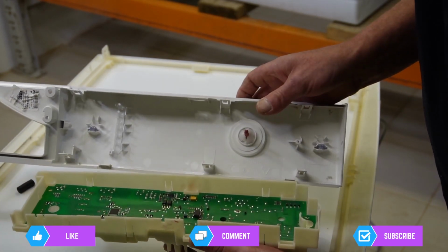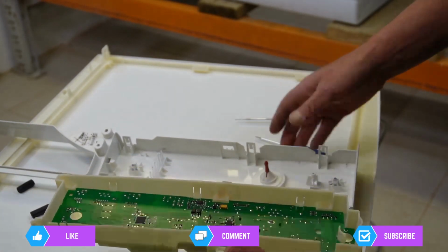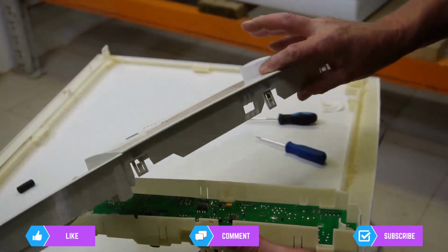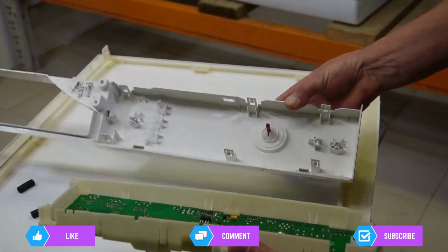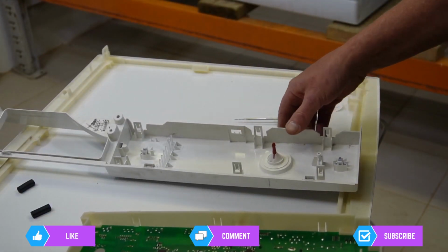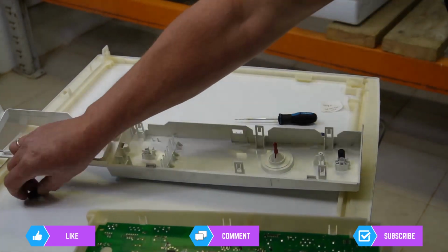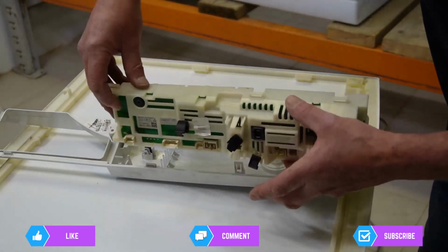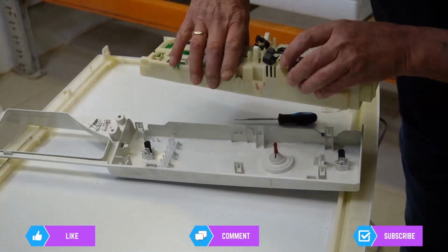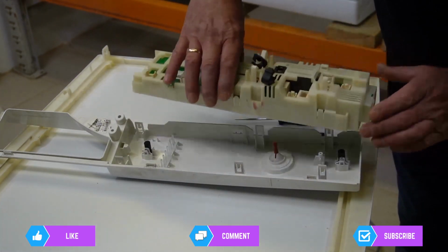Yep, he's actually sent this back by the look of it in the off position. And if I'm correct, that's the off position. So what we're going to do now is put these two rubber cushions in, and drop the circuit board onto the six locator lugs all the way round.